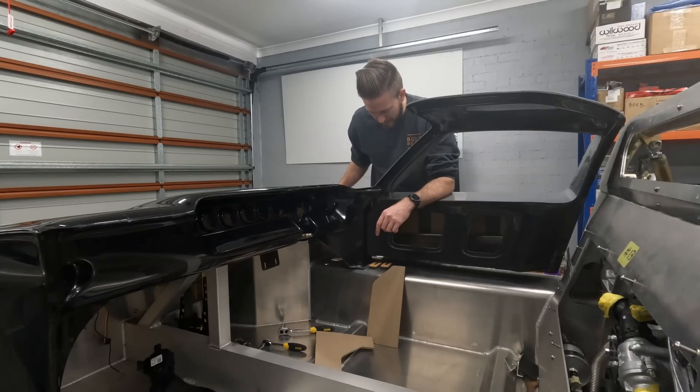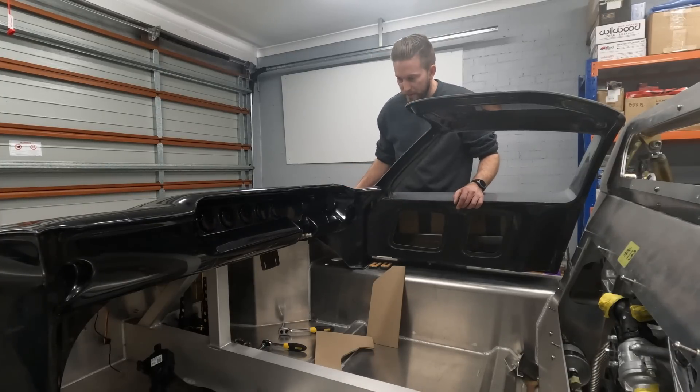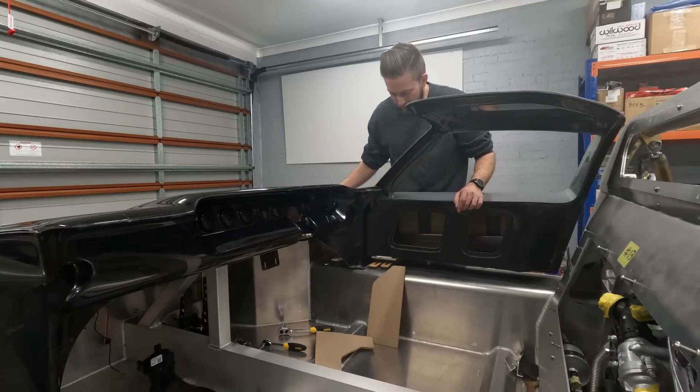At this stage I'm comfortable making a cut to try and lower the front by 10 millimeters. Rather than cutting the bottom just yet, I'm going to put a 10mm packer at the back to raise it and simulate rotating that shape, and I'll just have to trim a little bit on the sides. I'm trying to take baby steps so that I don't trim too much and end up having to fiberglass it all back up.